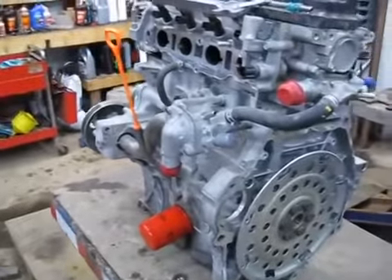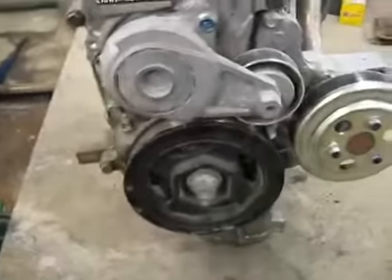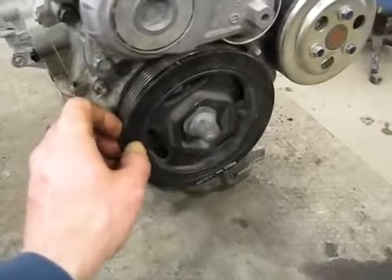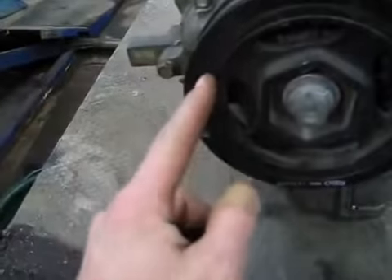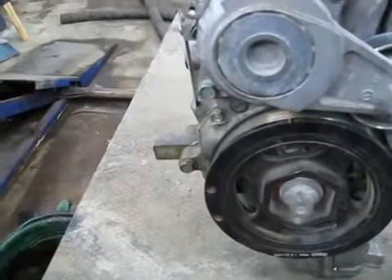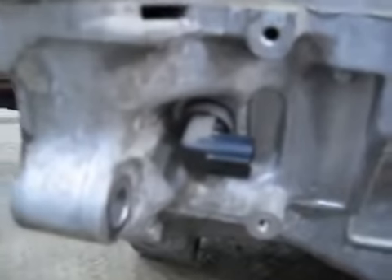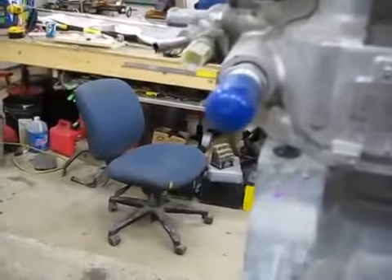So that's my take on the Honda Fit. If you guys have any questions, you can email me and I can take some measurements for you. There are companies out there making billet lightweight harmonic balancers — I'm not really a big fan of that idea. There's rubber cushioning in here that takes up vibration and harmonics, and I'll be leaving that just the way it is. I don't want to experiment with harmonic vibrations. That's the factory crank sensor, which I will not need. I can make a plug for that. Another heater core hose here.